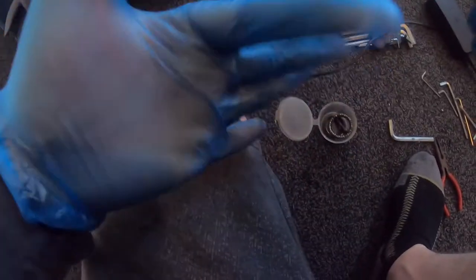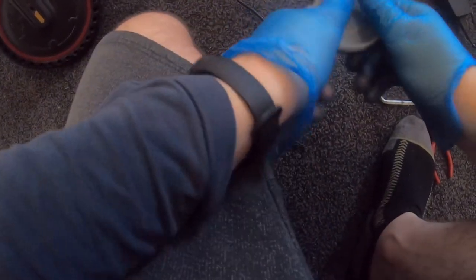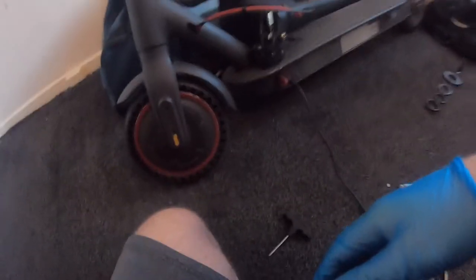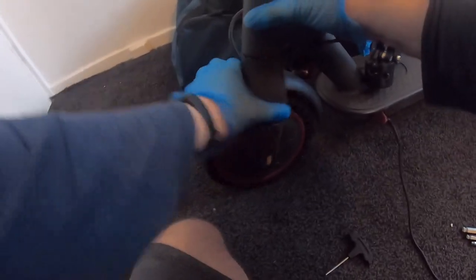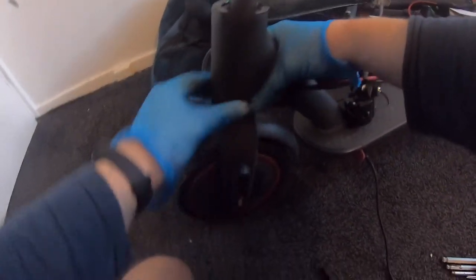Glove change — the old bearings I'm just going to put in a little pot, keep that to one side. This is the order I've got everything in, as you can see. We're going to put it back in the same order. Don't forget to subscribe — I do lots of different unboxing videos and different types of scooters as well. When you put the head stem in, just move it back and forth. As you can see at the top there, the bar moves — that way the bearings are sitting in place.